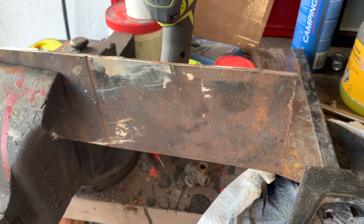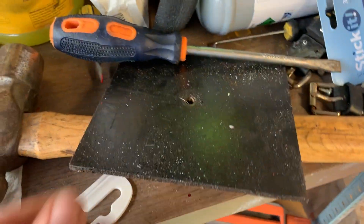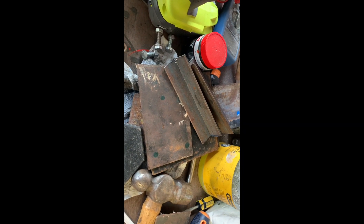Stuck out into the garage after work to do a bit more work on stuff for the car this weekend. First job is the handbrake bracket and I'm making this from scrap I've got lying around. The base plate is being made out of a piece of steel, these steel plates will be the upright, and I'll use some angle iron to bolt the two things together. I'm hoping that'll be strong enough once the handbrake is bolted between it with the retention bracket for the ratchet.